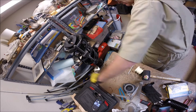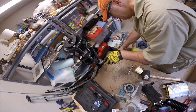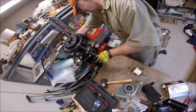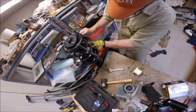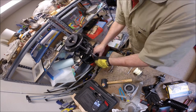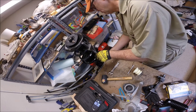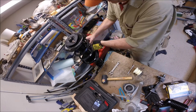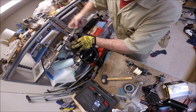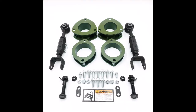Eventually I get everything back to the point where it's all pushed down just enough. I'm centering everything carefully - there goes the strut mount - and I get everything on carefully enough to start spinning that bolt down and get it secured. Then I carefully remove the spring compressors on each side. Don't use power tools - use your ratchet wrench and go 10 turns each side at a time, loosening until they're all off. This can be a chore, but once that top center bolt is on, it's much safer. Turn it down until it stops; you won't torque it until it gets on the vehicle.